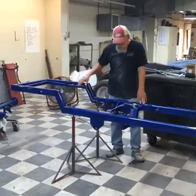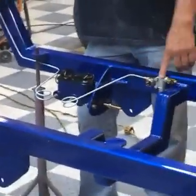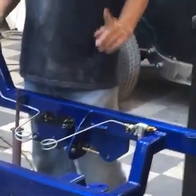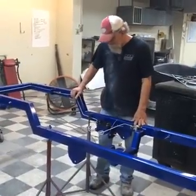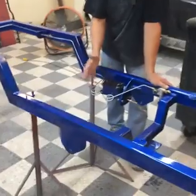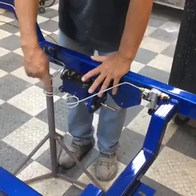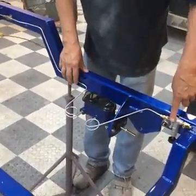What we're doing now is we're running the brake lines. And we've got the proportioning valve. So I'm going to go through some of the components, and I'm going to show you how to do a double flare. That's really a critical issue on doing a good brake line job. So we've got a master cylinder, and this is just a regular master cylinder, no power booster. You've got the lines coming out for the back. You've got lines coming out for the front.